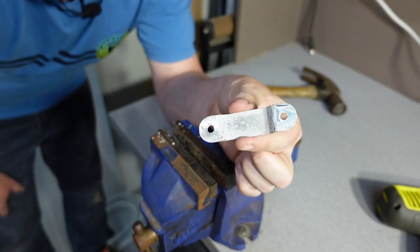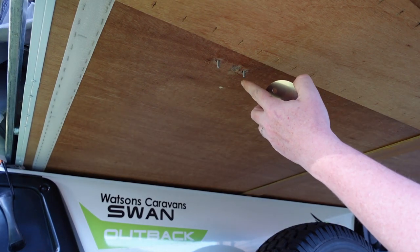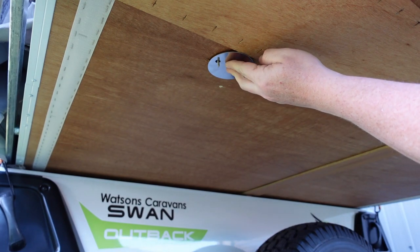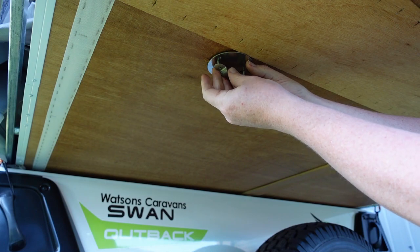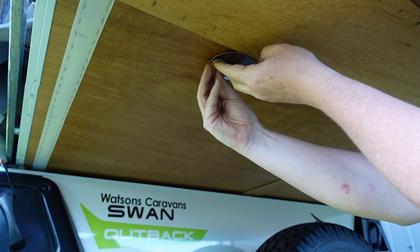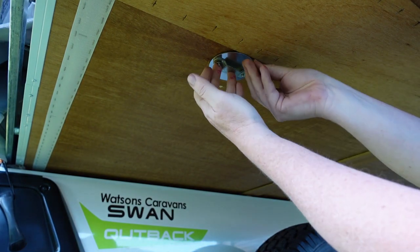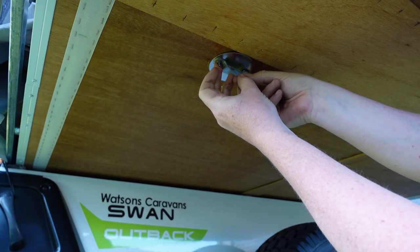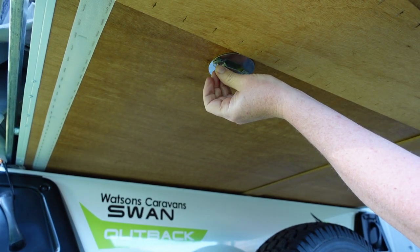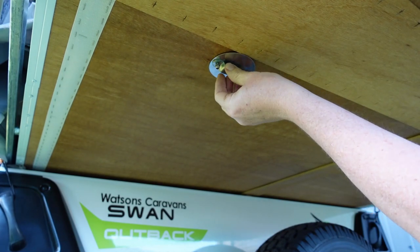Here we have a bracket ready to put in. Now for the tricky part — it might be easier if there's a second person to help. We've got the two bolts in from the top with the oversized washers, as per the instructions. You then put the plate in, followed by the original Jayco bracket, then the smaller washer. You then need to thread the very small nylock nut onto the underside without dropping the washer onto the ground. But it can be done. So that's one side on — I'll put the other nut and washer on now.